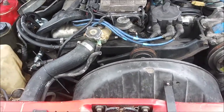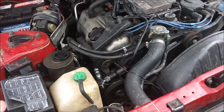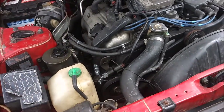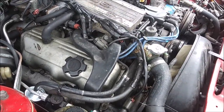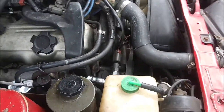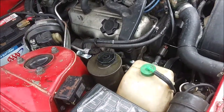The pros and cons of that: pros — it's a supercharger, so the boost will come in very predictably, and it'll drive very predictably. If for some reason I start off in third or second gear by accident, I won't be pushing too much boost at a low RPM, which makes tuning a little easier.